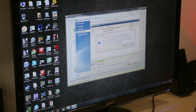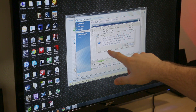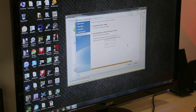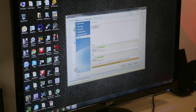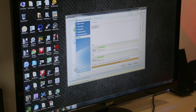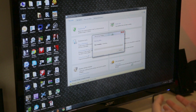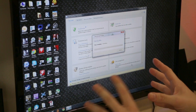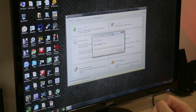Hit Next. It says the destination hard disk drive you've chosen contains partitions that could contain useful data — click OK to confirm deletion of all partitions on the destination. We want to copy partitions without changes, so we'll copy all partitions with no changes for a direct copy. Hit Next. Target disk and source disk are correctly identified, and we send it off to the races — Proceed. Now it's going to analyze the source and destination. This could take 20 to 25 minutes to actually perform, but as you can see it was just a few simple clicks. We'll let it run and come back to see how well it did.